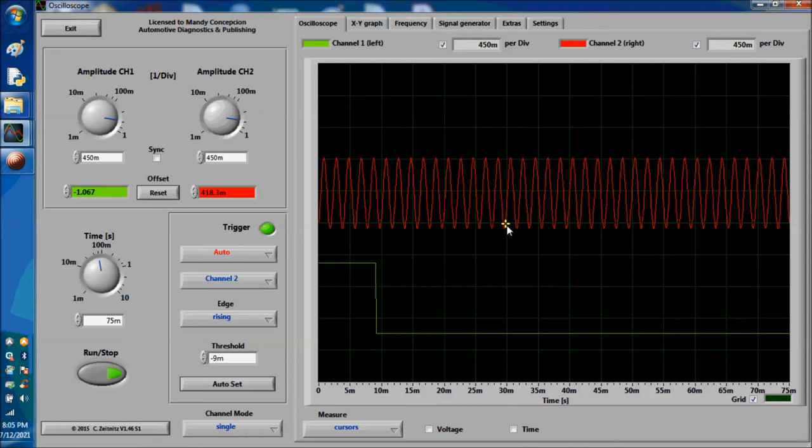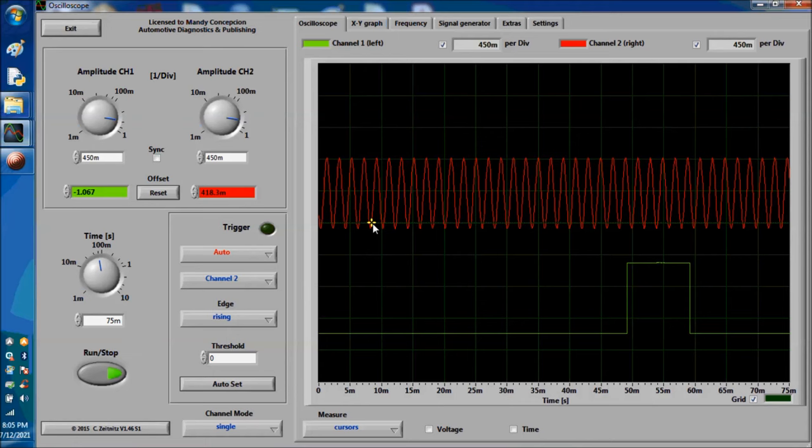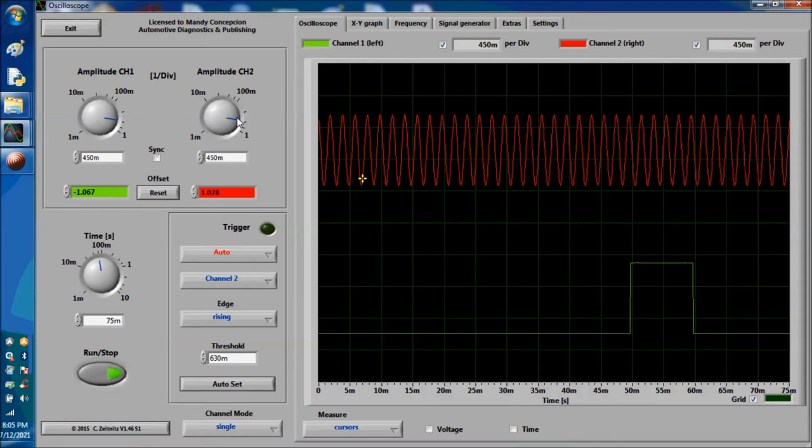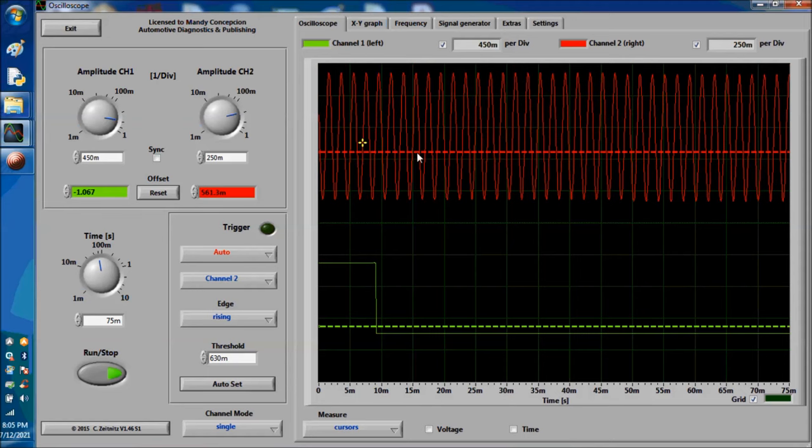You can also look at the crank reluctor, and right away you count the number of teeth on the reluctor, and right away you know, because these pulses on the crank sensor are the exact number of teeth that you have on the crank. Okay, now it's a little bit of work, but it's a lot better than doing the disassembly and tearing down the engine just to find out that there's nothing wrong with the cam and your issue is something else.